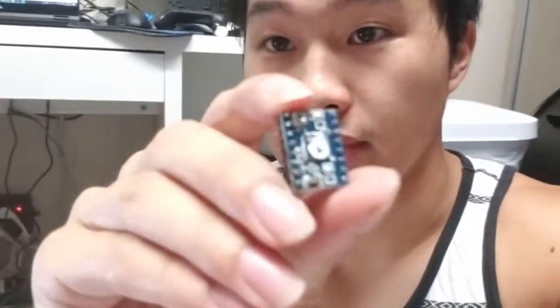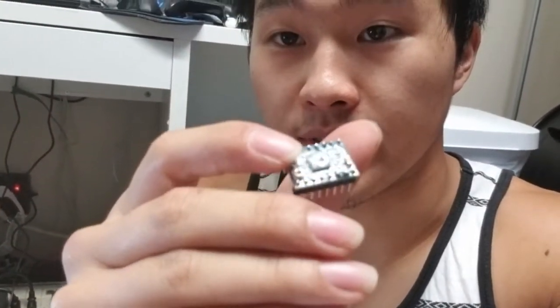There's one more thing I need to do — the heatsink fell off of this little circuit board. I'm going to clean it with some alcohol and a Q-tip, then reapply some thermal paste and put it back on. That should be it, and the printer should be up and running by then.